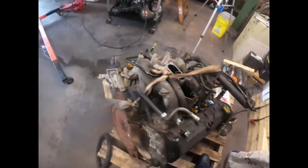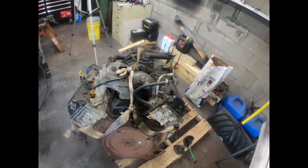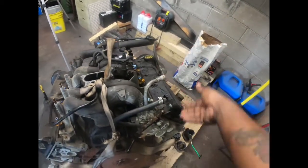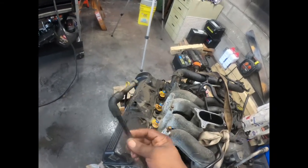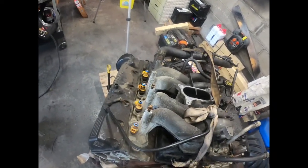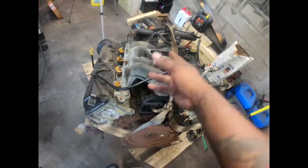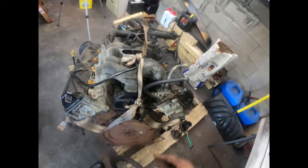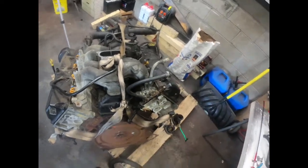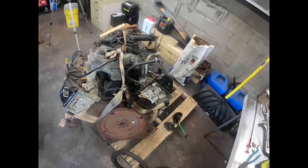I plugged off the fuel injector ports. So I'm gonna start blowing. Well, I already got a lot of mouse droppings out. That was around here and around here. Like I said, 80 Barber edition. This is seized on there, so I gotta get that off and just get these bolts out. And I'll be all done, but I'm about to blow these ports out. And while I'm blowing, I'm gonna be using the shop vac to try to suck up anything so all that mouse poop don't go around my garage.